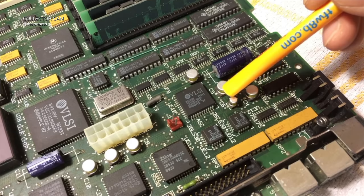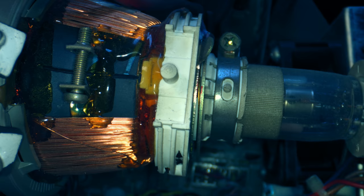The motherboard for this Mac was also redesigned. A big efficiency change was with the video circuitry — a custom gate array was used. That allowed the computer to continuously redraw graphics on the display while sending data to the video circuitry much quicker, which means less RAM had to be used. About a quarter of the RAM had to be used to help control the video, as opposed to half.